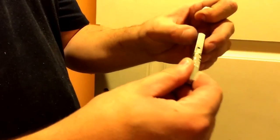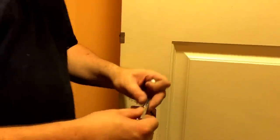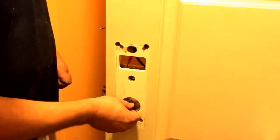You don't want this to be tight. You want it to be a quarter turn, half turn loose, because these work independently. One works one half of the hub and one works the other half. If it's tight, it's not going to work. So you want to back it, tighten it up, back it up a little bit. And I always put the hole vertical from the front to the back.